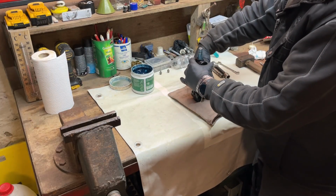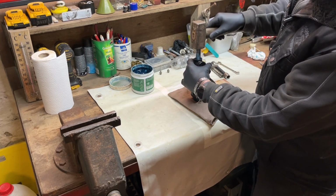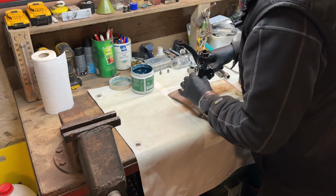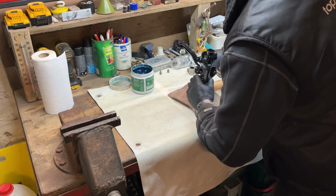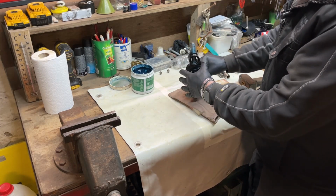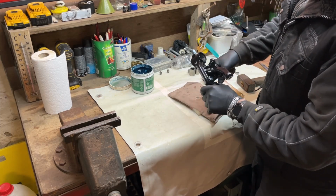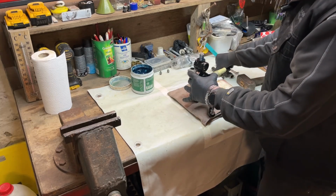We place that on our towel and we tap the little one a little bit in. Don't know if we are centered. You can watch that by looking on top. So this one is not centered. I have to go out a little bit. There it goes. You feel that it's sliding a little bit. So now we are tapping it in and we stop. And now we feel if the play is not too much. It's okay for the moment.